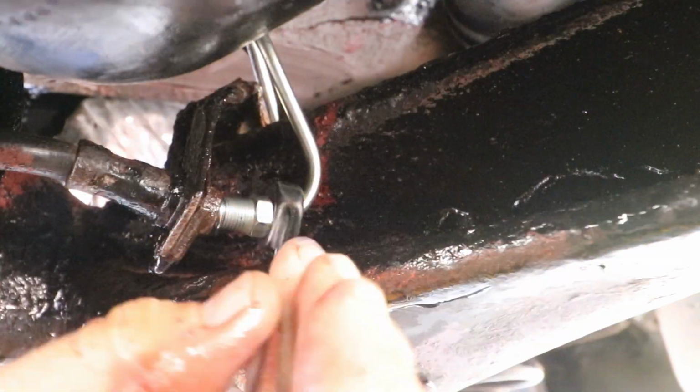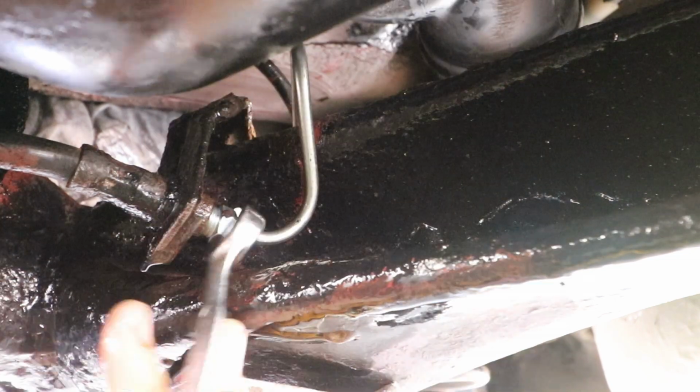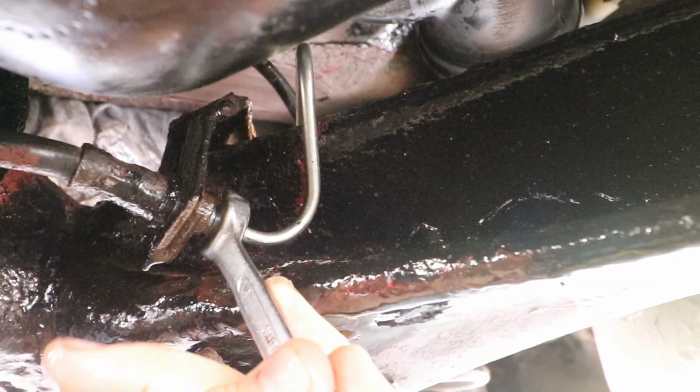And reattach the rear union nut, being careful not to cross-thread it. It actually took me quite a while to align this one and I had to move the camera out of the way just to get it started, so be mindful never to rush these. So keep jiggling the bolt and pipe until it goes in by hand easily. You should never try to force it.